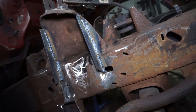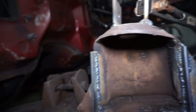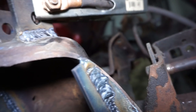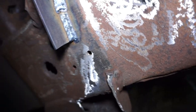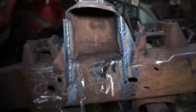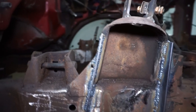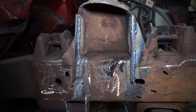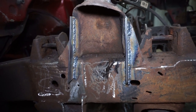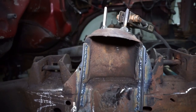I got two of the gussets welded in on this side. I'll probably attach a little piece in that corner so it doesn't look weird. I did cut one at a 45 because I don't like it sticking out at 90 degrees — I'll trim that one, but that's just being picky. It took a little getting used to with the welder since I'm using argon from the TIG — I had to turn the wire speed up faster than I normally would, but not too bad overall.